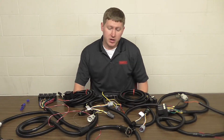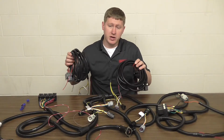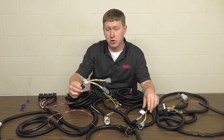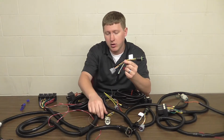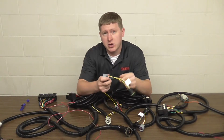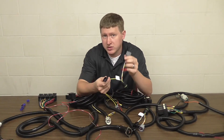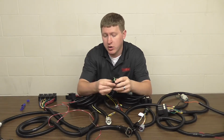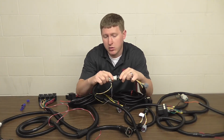The headlight adapter kit comes in 4 parts, with the 2 relay adapters and the 2 of the 3-way adapters. Starting with the upper set of headlights, we take the 3-way adapter and plug it in directly to the headlight assembly. We'll do that by disconnecting the plug that looks like these and plugging this in line. The 3rd connector goes directly to the underhood harness like so.